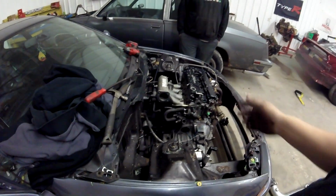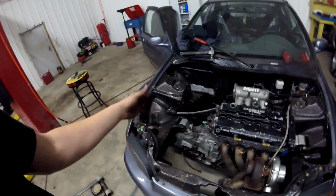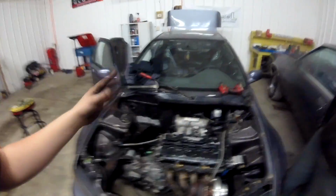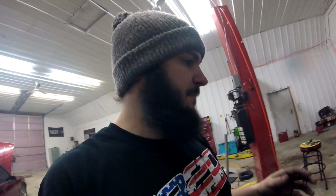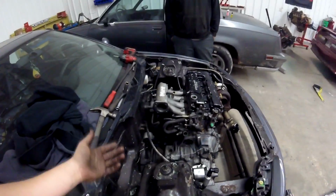When I had this car previously a few years ago, it had the blocks, coils in it, and bushings everywhere. I want to get some spherical bushings for the rear trailing arms, and some stiff bushings up front too, just to make this thing solid as hell so it doesn't have any give, because we want to plant all the power into the tire instead of into the suspension. That's the problem a lot of these little Hondas have: a lot of deflection in the control arms and everywhere, really, and it can cause things to shimmy around, cause wheel hop, cause axles to break, etc. So the stiffer you can make the car, if you run a drag slick, it'll put all the power into the slick instead of everywhere else. I don't know, I'm babbling right now, I could be totally wrong, but that's my need-sleep assumption. Yeah, hell yeah, I'm excited.